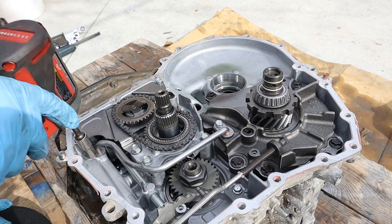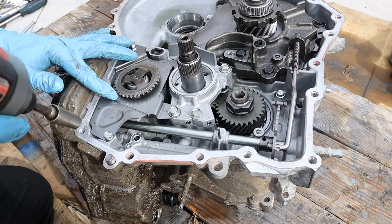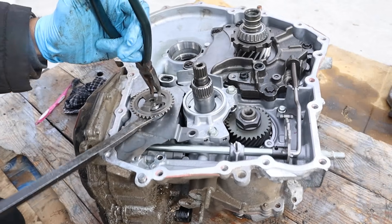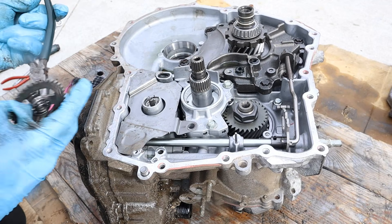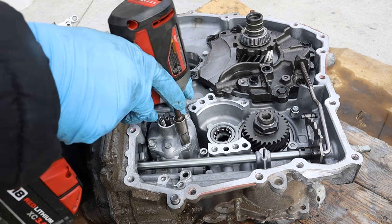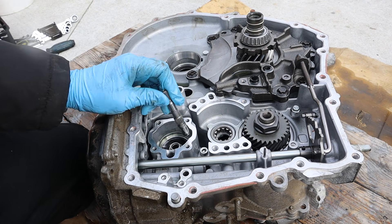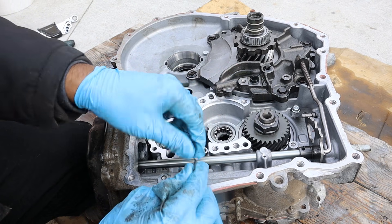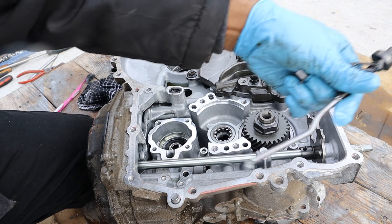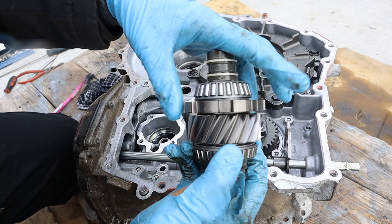I'm going to pull out the final drive, pop off this hydraulic tube, and remove the oil pump drive gear — it's chain driven. I'll unbolt the oil pump here; there's a little snap ring inside. I'm going to wiggle this thing out — there's a bearing pressed into that hole. I'll take off this plate, get these two other bolts, and take off the input part. Popping off the tens at the oil pump housing, this is the housing for the oil pump. I'm working on removing this manual valve — pulling out this little pin, a little arm, and the parking pawl. A little countershaft pops out; you can see it's got two bearings on it. That's where the parking pawl locks in.